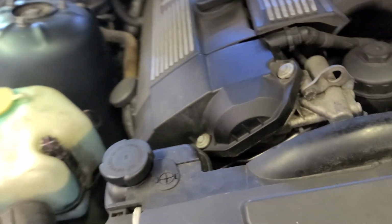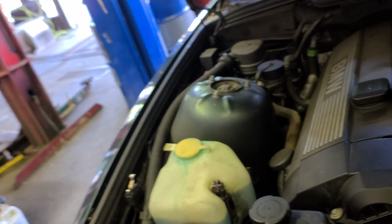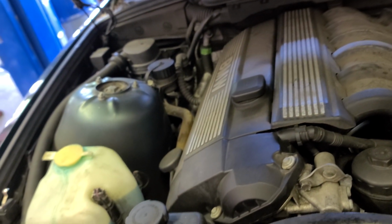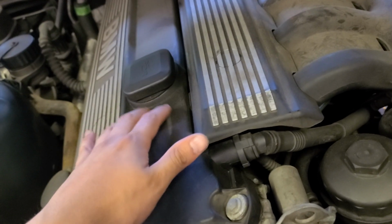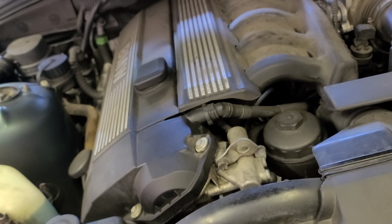Because in this car, the owner was putting in coolant every 2 days or something like that. He didn't pay attention if there was a puddle under the car, until he came to the masters, and the masters said you gotta check underneath for a puddle. If you see a puddle, that's good, because if there's no puddle but you're losing coolant, then the engine might be eating it, and that means there's a head gasket.